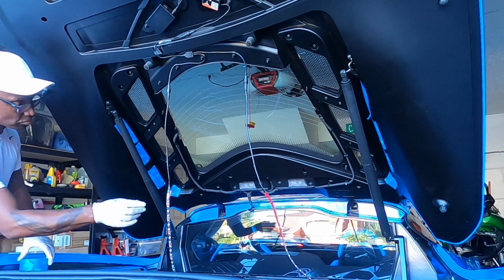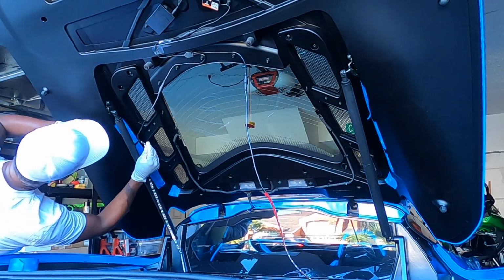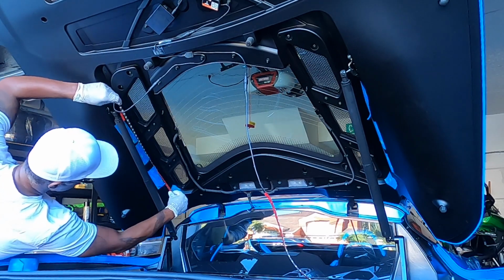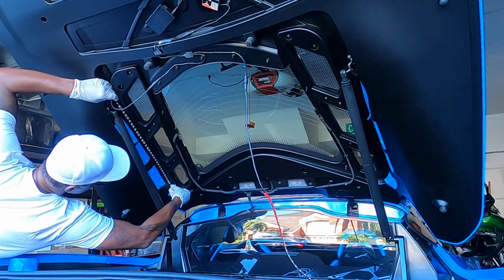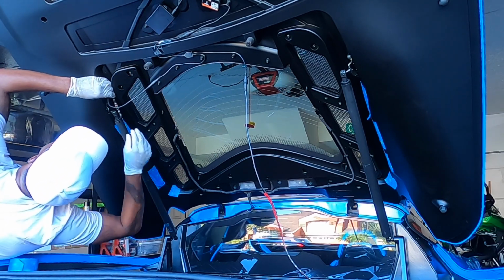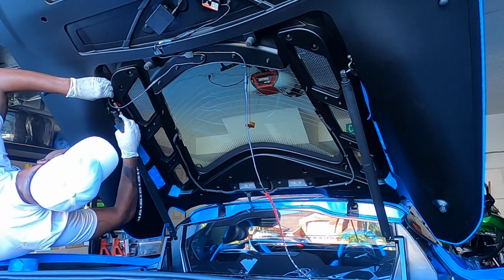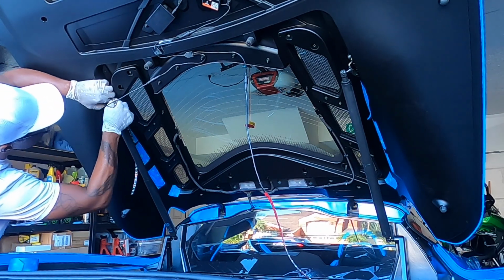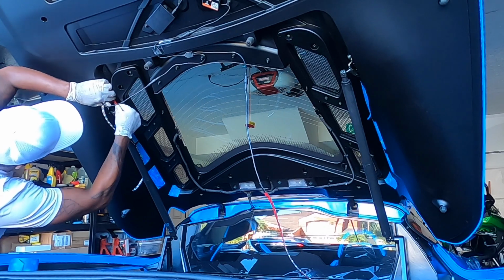Now I've already applied the adhesion promoter adjacent to the painter's tape, and I'm ready to install the LEDs themselves. Based on the eyeball test I did earlier, I know just where to begin my installation, toward the rear of the hatch. So I use that information to start where I'm going to do it.